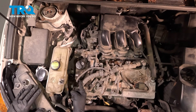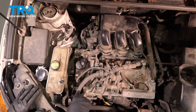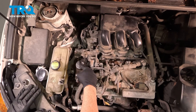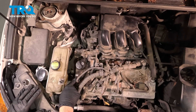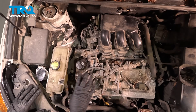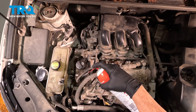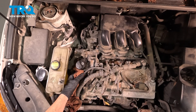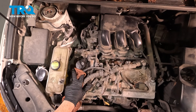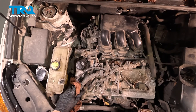You want to go ahead and disconnect the electrical connector. In our particular case, we have a little bit of debris and oil spillage here, probably from our oil fill cap. If you have that, you want to go ahead and clean that up because you're going to be exposing the internals of the engine — you don't want any debris falling inside. We're simply going to use some spray solvent to clean up around this. If you just have some light debris, you can use an air hose or compressed air to clean up around that.